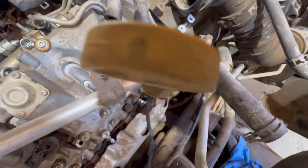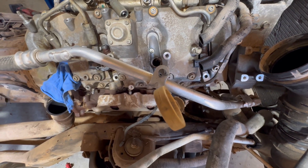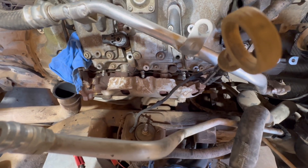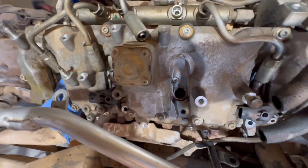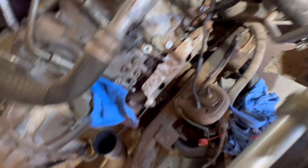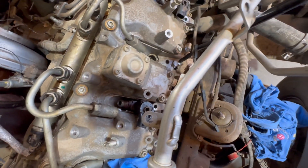You can see in the hole it's pretty gunked up. We'll get it cleaned out. I use a wire brush like the kind for cleaning a shotgun barrel, put it on a drill, spray brake clean all down in there, and really clean it nice. If you don't clean it and the injector won't sink down, you'll have a leaking injector and be back at square one. Really, really clean them. For ones that are harder to remove, use a small pry bar or a dedicated puller tool. Then put rags in the holes to cover everything.